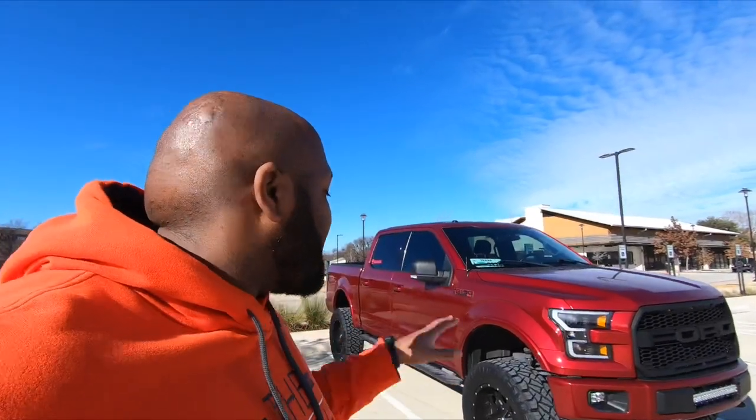What I'm going to do — I'm not going to air out these tires and do the test sets over and over here. I'm going to go to Discount Tire, less than a mile from my house, so my tires should still be pretty cold. Ideally when you want to check tire pressure you want to do it cold, and if you have to add air, try to drive no more than a mile to keep an accurate reading. I'm dropping down to 40 PSI, coming back to do the test again. I'm going to leave it at 40 unless I get another time where my tires are cold, because once heated the reading won't be accurate.